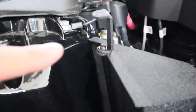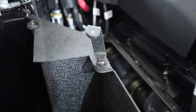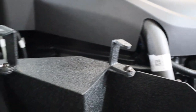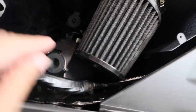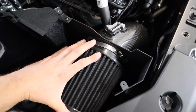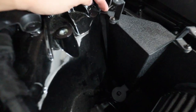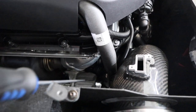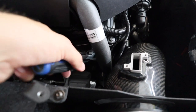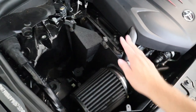Double-check the bracket orientation: the lower bracket is slightly bent upwards, and the upper one is 90 degrees — the longer end is on the bottom, bent slightly differently so it lines up. Then slide your air filter into place; it might be a little tight near the fender liner so wiggle it around to line it up. Once lined up, tighten the clamp on the air filter and pull the heat shield toward the base of the filter to keep it aligned with the strut tower. With the air filter clamped, use a long flat head to find and tighten the clamp connecting the intake tube at the turbo. Push the pipe downwards slightly to help seat the heat shield into the grommets, then tighten that clamp.